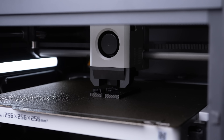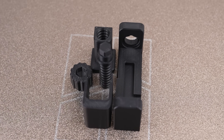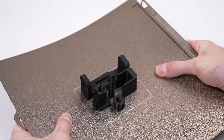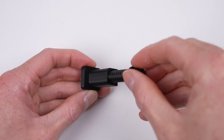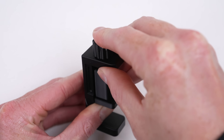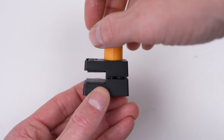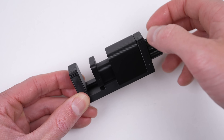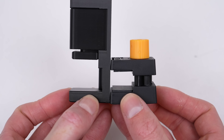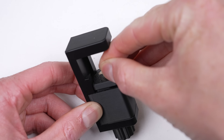I tried some clamps — a somewhat universal tool which I use for keeping pressure on a screen or back panel when using liquid adhesive. A clamp stops it moving around and ensures a firm connection while the glue cures. These turned out great. It prints in several pieces, so you'll need to assemble them. The left-handed thread caught me off guard, but after reading the assembly instructions, I figured it out. I have a set of similar clamps already, but on more than one occasion they don't open anywhere near far enough. This 3D printed version is much larger and exactly what I was looking for. Though the plastic is slippery, so adding two pieces of rubber will prevent movement of the clamped object. This tool is certainly my favourite so far.